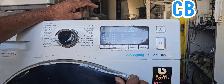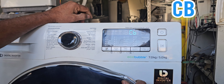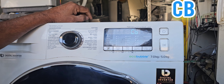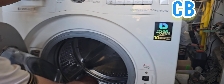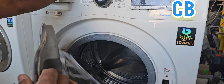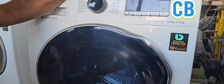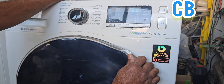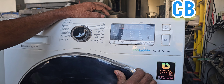After pressing this, it will take about two to three minutes, and then it will show zero and the buzzer will sound. That is why the drum must always be empty — do not try to do this with a load inside. If you do, it will mix up the calibration system and it won't calibrate properly. Now I will activate the calibration — the door is already locked.